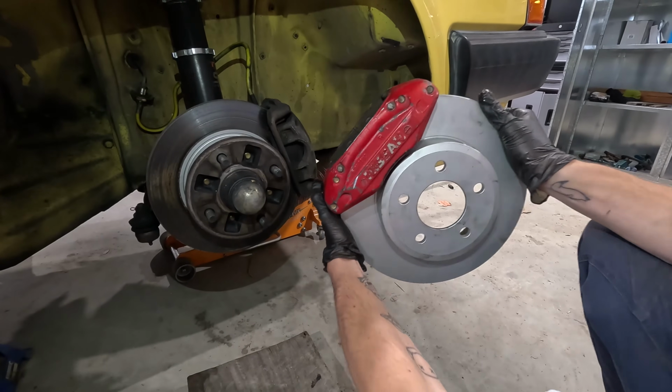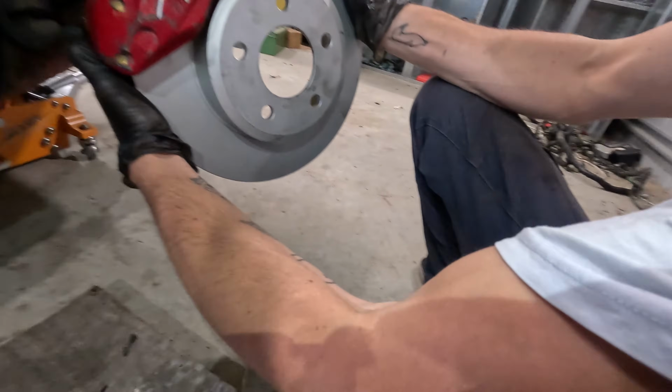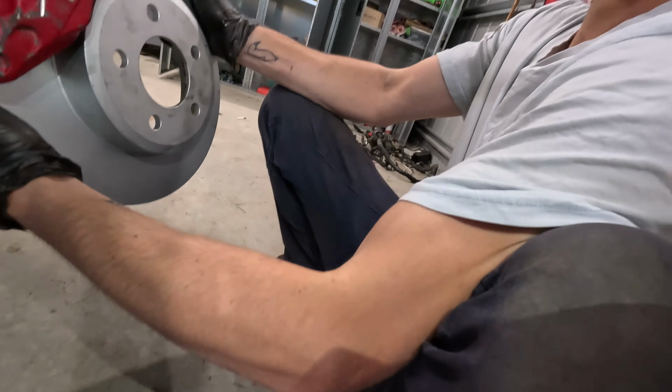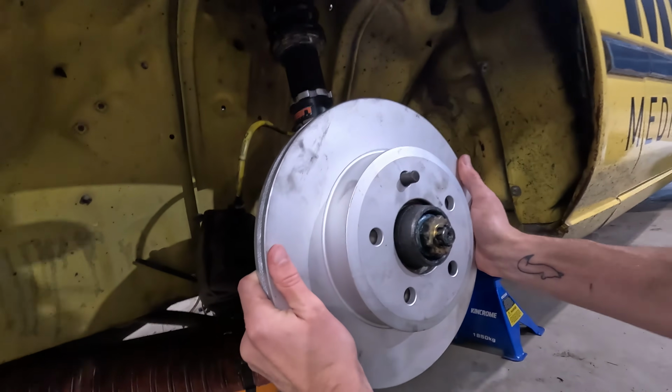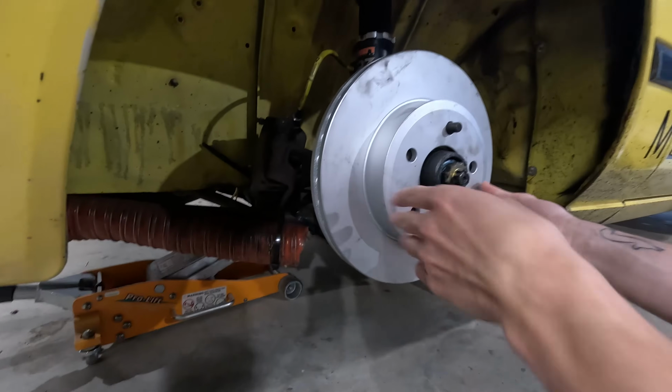So we basically just went out on a limb and said, yeah, this seems about right. So we purchased some second-hand R33 calipers, we got some new BA discs, got them re-drilled to the right PCD, got our parts compiled, put them on the car, and it basically just completely worked. Oof. Yes! That looks incredible.